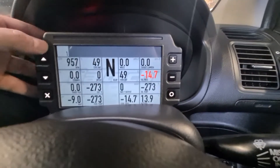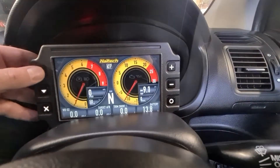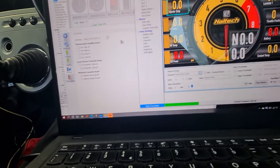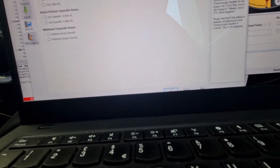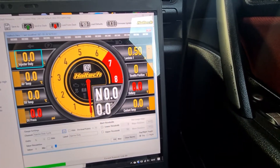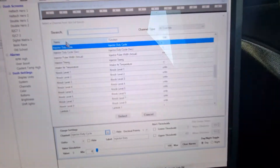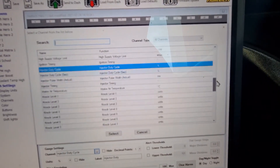And we've got the data on there now. Basically anything that we've got on the ECU — here's the ECU software — and we can add different expansion boxes like temperature boxes, thermocouples, IOs, widebands and things. Anything we've got on this Platinum ECU, we can drive directly to the display. So we can pick on, say, this one here — I've got this down as injector duty at the moment — we double click on it and then we've got a pull down menu where we can basically select anything that we've allocated on there.